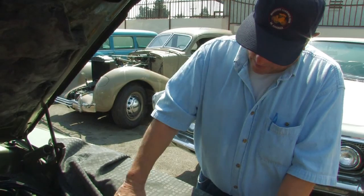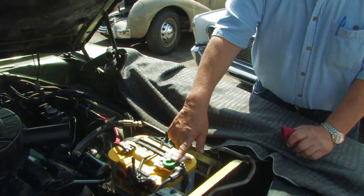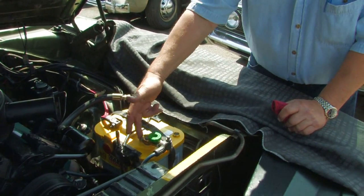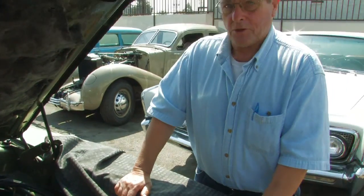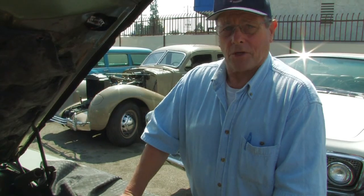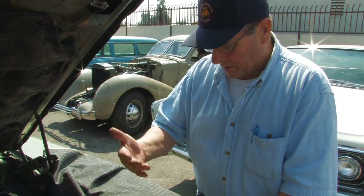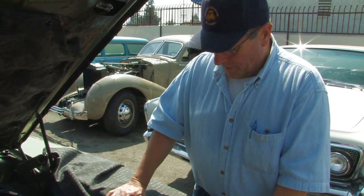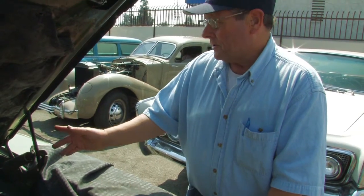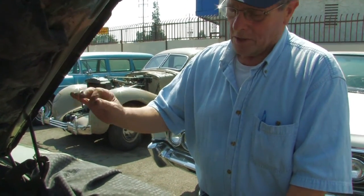On this car, which is a hobby car, I have a battery cutoff switch right here. When this vehicle is parked, all I do is unscrew the switch like this. These are very inexpensive — you can buy them for about $10 or $12. All the electrical power is cut off in the car, so I don't have to worry about something shorting out or something happening when I'm not around, and the battery's not going to drain as rapidly. On some newer cars, you want to be concerned about your presets. On this car, I don't have to worry about losing the presets on the radio because they're mechanical.